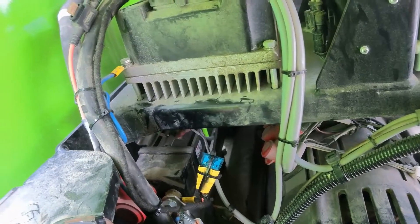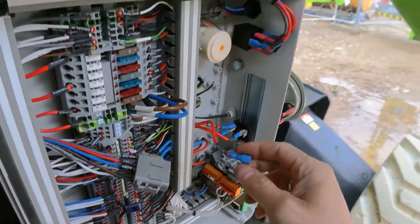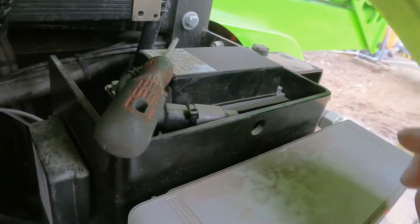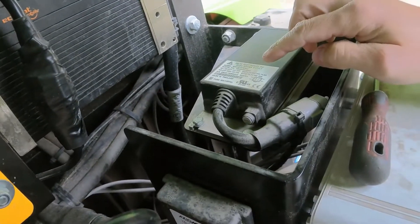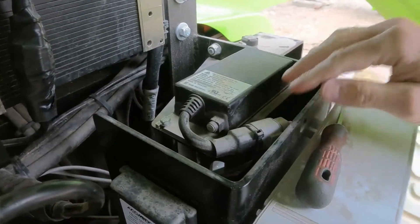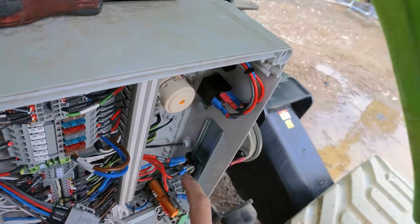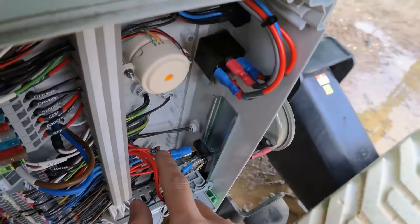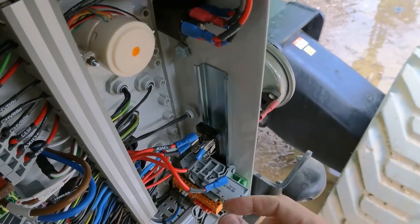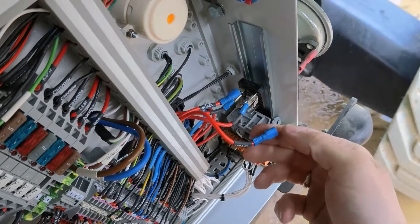Let's try to see what's happening. Looking at the wiring, everything seems okay with no obvious problems. I think the problem may actually be this voltage converter here, because the fuse that keeps blowing is feeding this converter. I've got 12.7 volts on the DF wire — that's my diesel feed wire from the 12V batteries — and 14 volts on the 12VSD output from this converter.